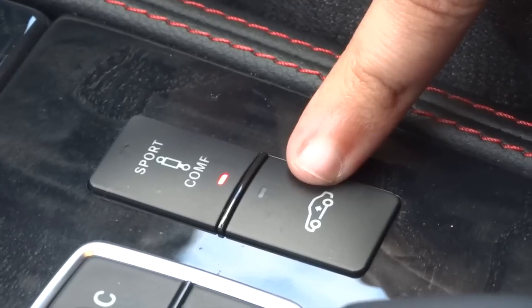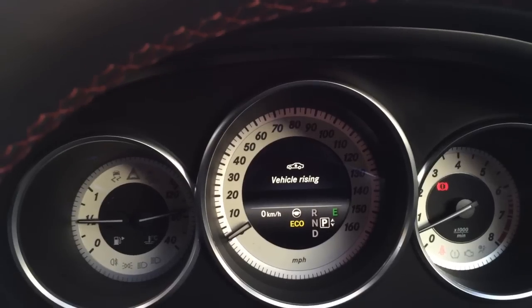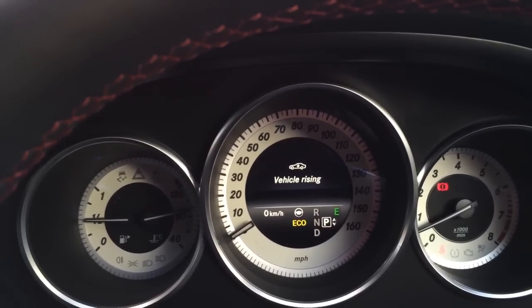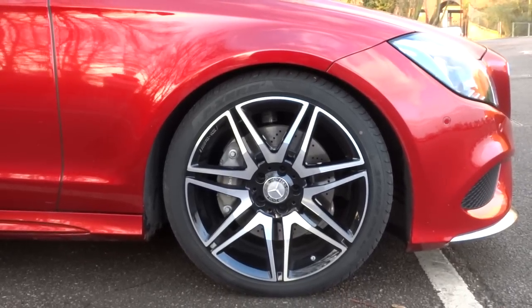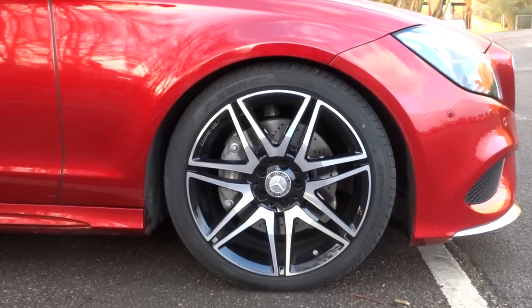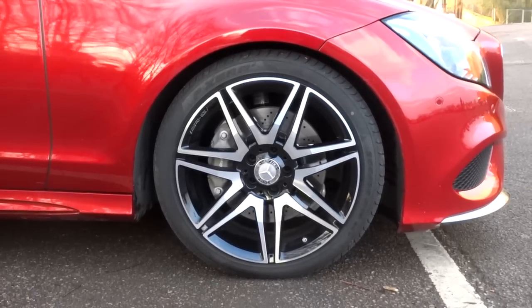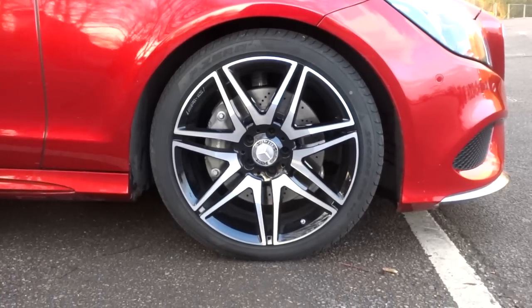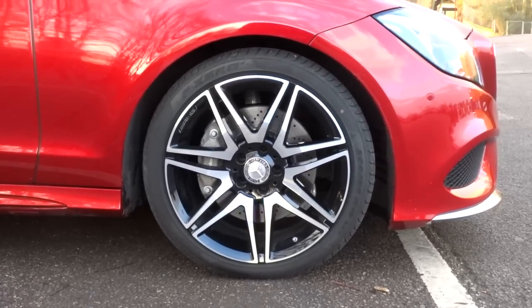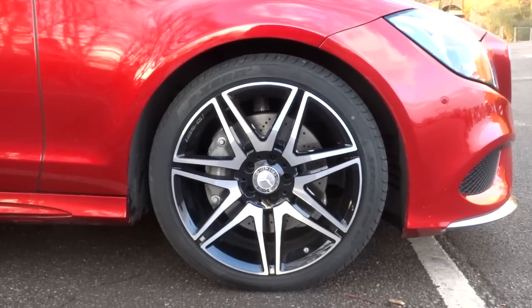The vehicle ride height can also be increased to its maximum by pressing the ride height button on the console. This will bring up a notification in the dashboard stating that the vehicle is rising. The vehicle then changes from whichever mode it is in, even whilst in motion, and raises itself to its highest position, which is about 50 millimetres in total higher than in sport suspension mode. The process takes about 1 minute 30 seconds when moving from sport suspension, and has been time-lapsed for the purposes of this video.